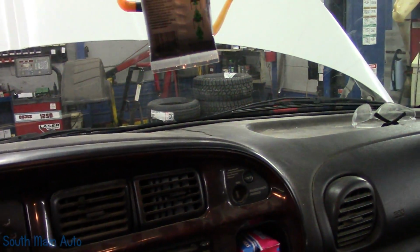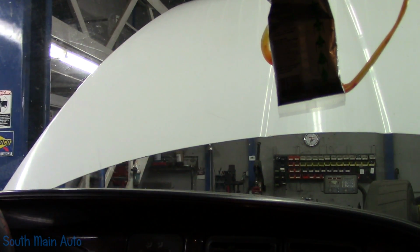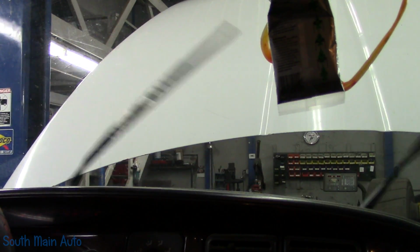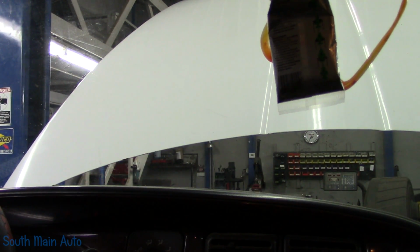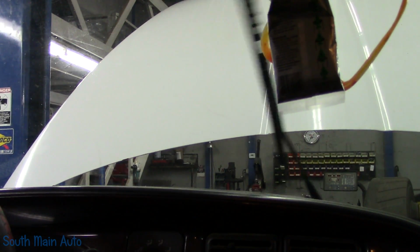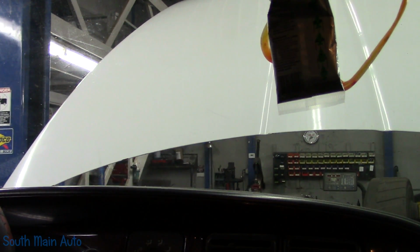So it appears that it's essentially, I think this is going to be the shortest video I ever made. Like I said, I don't think this had anything to do with the intermittent wipers, but let's just see. So it's high, low. This is intermittent. What do you know? Must be the intermittent wipers fed off that circuit also, because they work now.